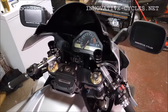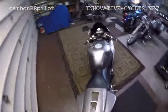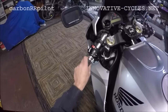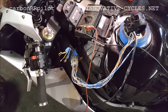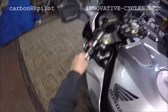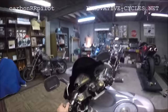That might be a video for anybody who wants to put an aftermarket CBR stabilizer in without having that big gaping hole. Basically with the mirrors, normally there'd be an on/off switch somewhere in the fairing. But this is actually a Gixxer control module, which is going to be another video. It's got extra buttons for mode up and mode down, a pass button which the Honda doesn't have, and a hazard button — the bike doesn't have hazards anyway, but now I'm using that button for the mirrors.